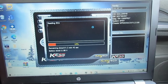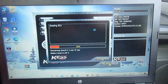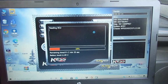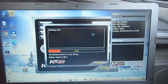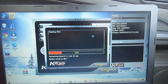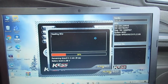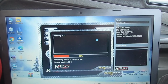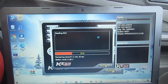I have tried... On one of my previous vehicles, I had a Zafira GSI with the Z20 LET 2-litre turbo in. I had it eventually running at 245 brake horsepower. For a 7-seater, that's quite quick. It did have a VXR turbo on it. It was already on when I bought it. But I found a mapper, and I got some maps from him, and they're just generic maps, and with trial and error with a Galetto, I could read and write to my ECU on that quite easily.